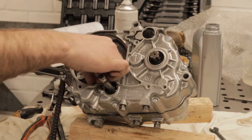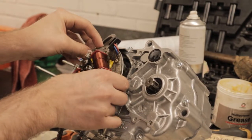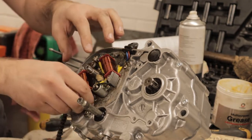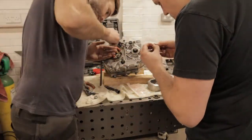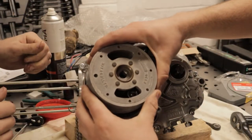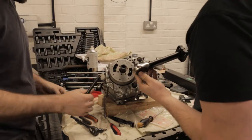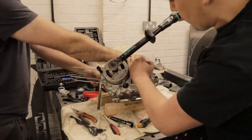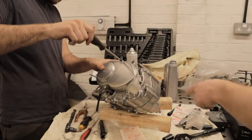With a quick cleanup we look to finalize this lower area. On top of your cam chain tensioner you have the ignition, so this is your stator and points - that goes on as one unit and screws in. It's really important to focus on getting the sealing properly, as that whole stator separates a wet and dry side, so remember to put the seal in there otherwise you will have problems. On top of that goes the flywheel, and that is pretty much the bottom end all done.